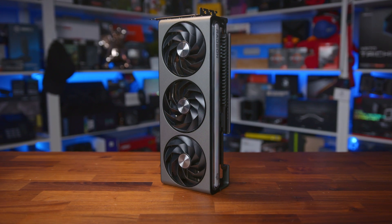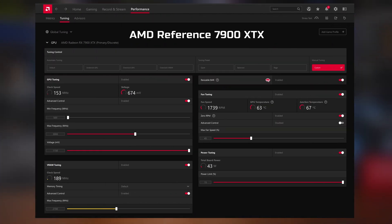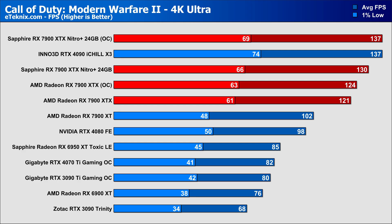So while overclocking is becoming more of a dying art, it is still worth looking at — especially with the ability to undervolt these cards to get small boosts in performance for less power and heat. It's here where we see another key difference: while both cards were able to be overclocked to the same level, with a max boost frequency of 3,000 MHz and memory frequency of 2,700 MHz with a 115% power limit, the AMD reference card had to remain at the same stock voltage, while the Sapphire card, likely due to its superior cooler, was able to be undervolted by 50 millivolts. With our overclock now running, it's time to boot up our game tests again.